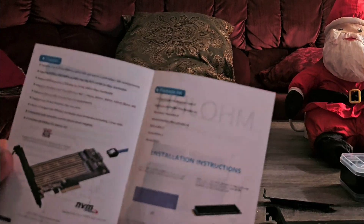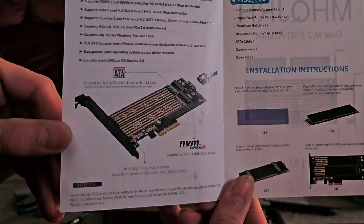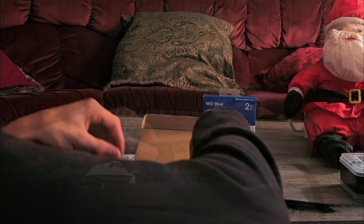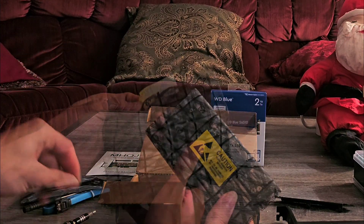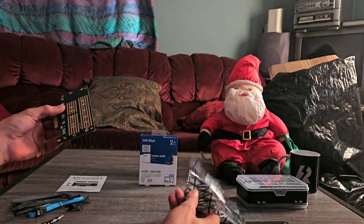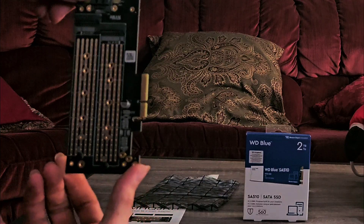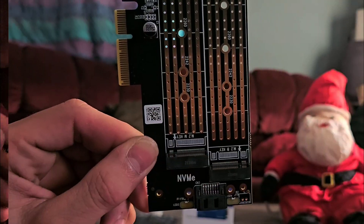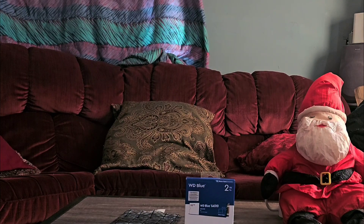But to make it where I don't need to go into the motherboard settings and tell the device how to operate, I've gone with a dual M.2 SSD expansion board that uses a SATA connection for the second M.2, which is a little slower but that will be the trade-off. That way I can get extra storage without enabling any special motherboard features — most motherboards under $400 wouldn't have that feature anyway.